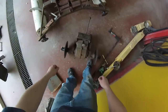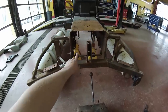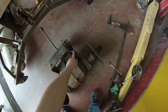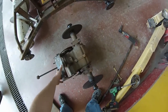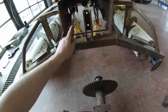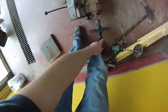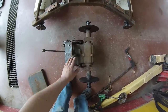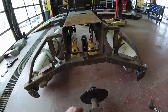So here's the transmission out of the tractor. Normally it would be sitting in there just like that — I've taken it out of this space here. My plan, instead of having the gearboxes this way, this is the input drive of the transmission, which happens to be in the right direction. I'm going to spin this transmission this way and drive it with a shaft instead of a belt. There will be a shaft going this way up to the motor, maybe to that PTO up there. Then I'll be able to drive the tracks directly off of the axle on each side. Somehow I'm going to have to get this mounted inside there the wrong way, so we'll see how that goes.